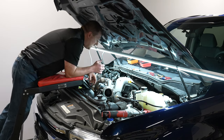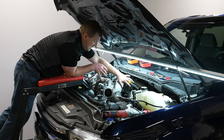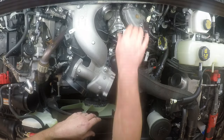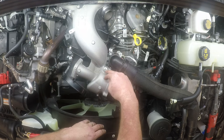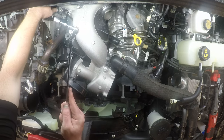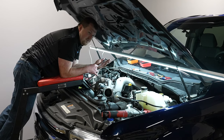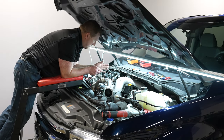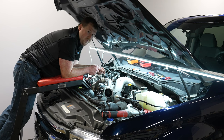Next, we're going to pull the intake manifold bolts on both upper and lower plenums. On these newer trucks, we'll remove both pieces together as one piece — that's mainly all 8mm bolts in the back. We've already removed the dipstick tube. There are also some 10mm bolts holding the lower intake plenum on. Some of the back 8mm bolts are fairly difficult to get to, especially the one under the pressure sensor bracket — a flex-head ratchet helps to access that back bolt. I'll go ahead and zip all these bolts out and then show you removing these two intake manifolds as one piece.